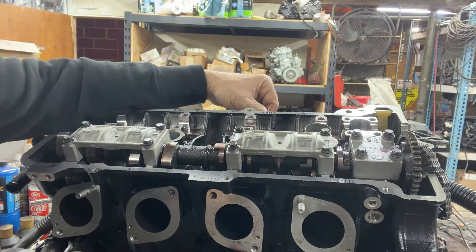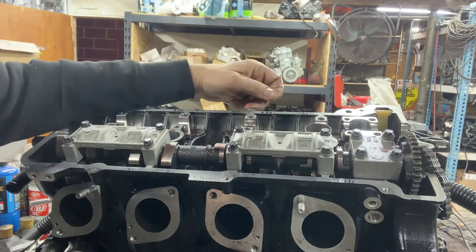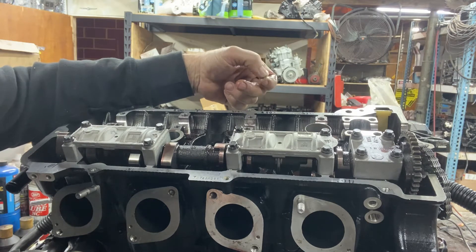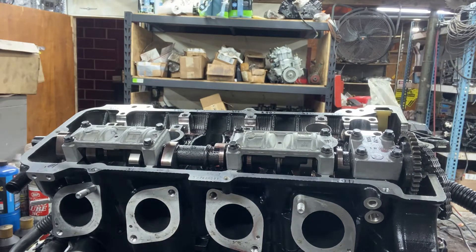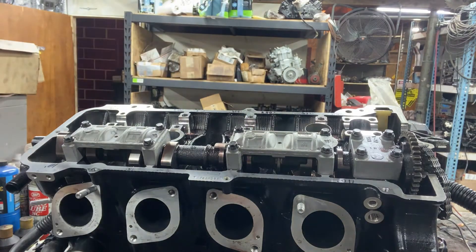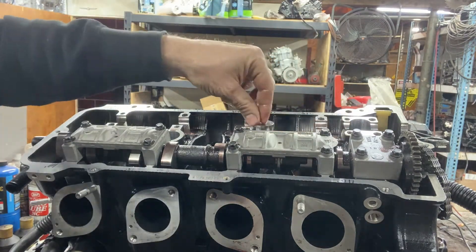Wait - I'm tightening it up by going up on the number. I'm about to screw that one up. I want to go down on the number because the space is too small. If I add a thicker shim, the space is going to get even smaller. So that one is no good. The clearance is at 8, so a shim that's 3 thousandths smaller should bring it up to 11 thousandths. That one should be right.